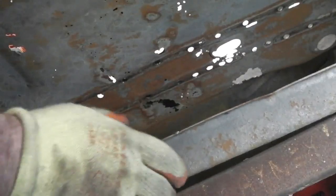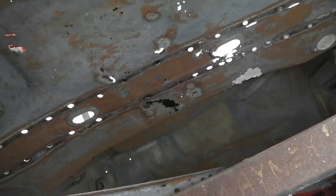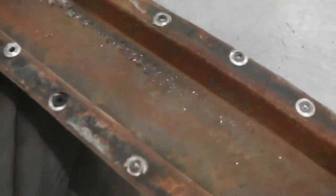Surprisingly, and it did surprise me, it totally rotted out at the front where everything had gone at the bulkhead. It was wet in the floor, so the car had rotted from the driver's side and was heading back. The middle section of the car held up, especially on the chassis. When we look at this chassis now, it's all been cleaned, of course, because the car was dipped. See, that could have been used. That actually didn't need to be replaced.